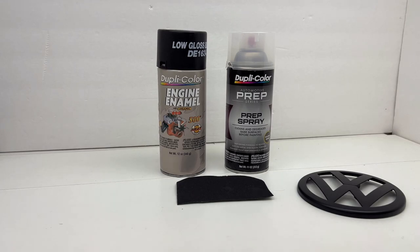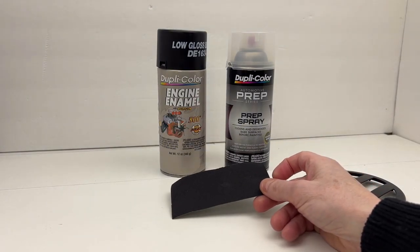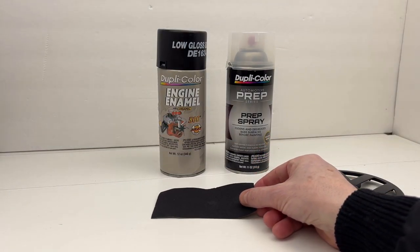The sanding process, depending upon what you're painting, I normally go with either 320 or 400 grit wet-dry sandpaper like this — this is a 400 grit wet-dry sandpaper. Your sandpaper will last a lot longer if you wet sand your item and keep the sandpaper wet, so that's what I always do. You don't need a lot of sandpaper to prep your emblem, especially if it's new. Mine was old, had a lot of rock chips on it, so it required a bit more sanding to get a smooth surface — I went through probably four or five of these little pieces.